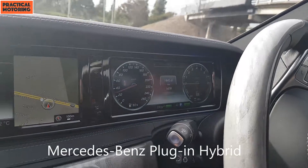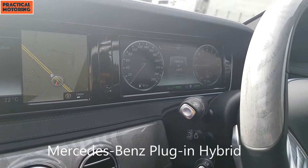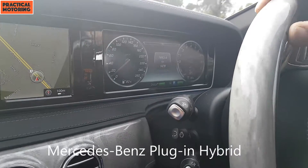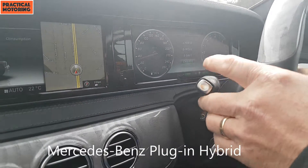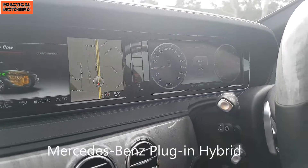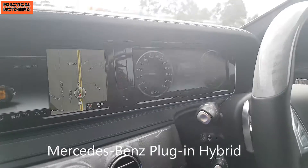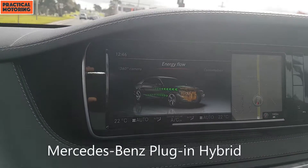If you know you're coming up to an area where you want a lot of electrical power, you can save the battery for that — you could say don't go below 50% battery. The graph is always showing you what you have available. The fourth mode is Charge mode, which means we're running on the petrol engine and actively recharging the electrical battery. So if you know you're coming up to an area where you want electricity, you charge it up beforehand — enough power to sneak in quietly after a night out and not disturb anyone.